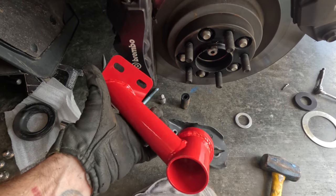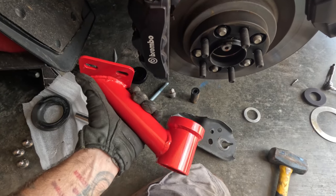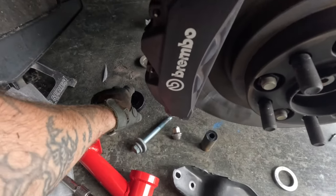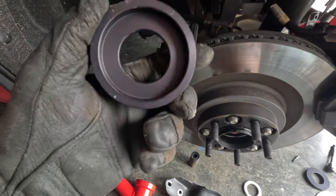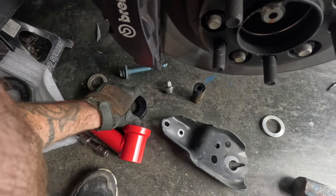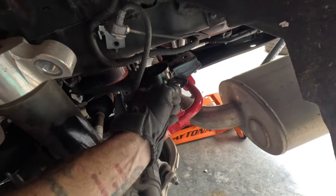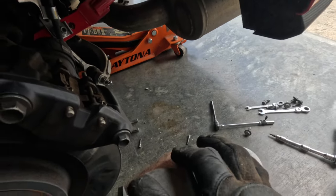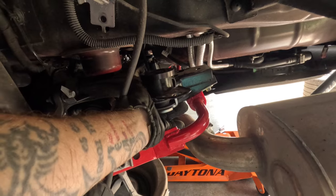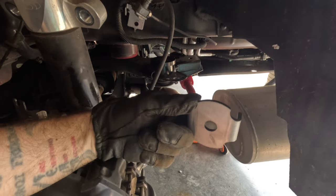If you're unfamiliar with the CB005 — right here, that is a built-in centering sleeve that keeps this centered. When you run your bolt through, it's going to center up the front, and it's going to replace this stamped steel flexible piece of crap right here. It just flat out works. You don't need any of that extra stuff. The CB005 gets rid of 95-plus percent of your wheel hop for about 200 bucks or less. This piece goes over the top and captures the metal around the bushing. In the rear, same deal — over the top, captures completely over the metal, sandwiches everything together. Run your bolt through, torque it down to 129 pound-feet, and it's not going to rotate left, right, or forward. It's going to be completely solid. That's why it works so well.